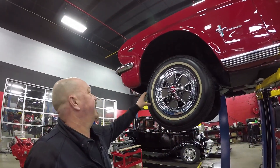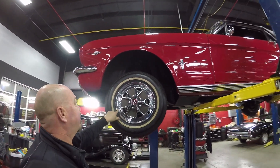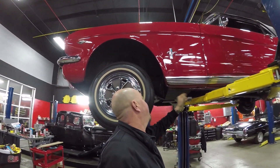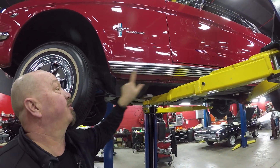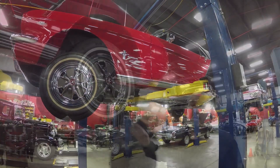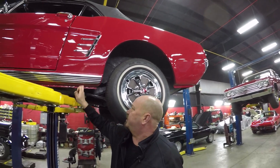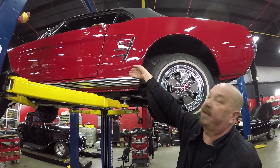Now let's look at wheels and tires. Up front we've got some white walls — 195-75-14s. These are hubcaps that look like styled steel rims, but they are hubcaps so you've got to pull the hubcap off to get to the lug nuts underneath — these are fakies. Look at that paint work right down to the bottom edge; I don't feel any patchwork in there whatsoever, so that's good solid metal. That rocker molding also looks original to the car — that tells you this car was very well kept. Out back we've also got 195-75-14s. This lip where the inner wheelhouse meets the quarter feels nice and clean. Take a look at the bottom side of these rockers — that's actually a factory hole to let moisture out — and the paint work right down to the bottom edge is beautiful.